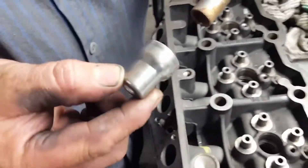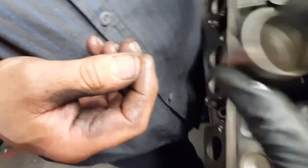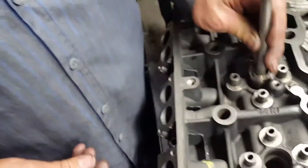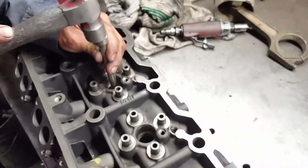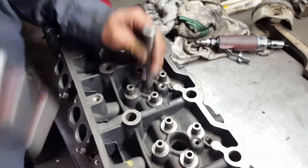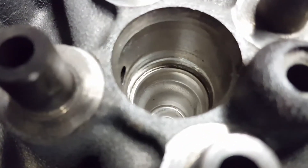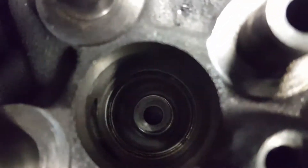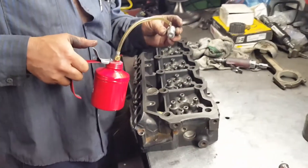That's the new sleeve, not yet installed. You need a little socket, whatever fits in here — it's a flat all the way down. We're using a 7/16 socket, it's gonna go in there. Put some little oil around the sleeve and it's hammered down all the way — nice and easy, there you go, very good, nice and sealed. This is a 6.0 diesel engine on a Ford F450, 2006-2009. That's how you replace it and that's how you install it.